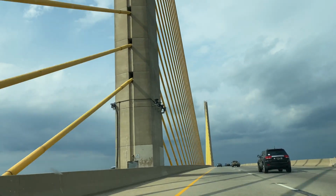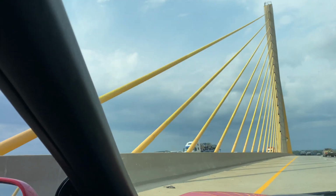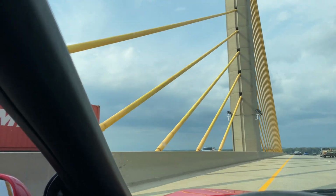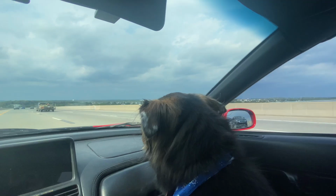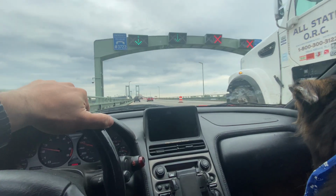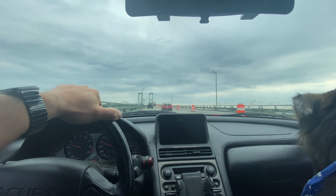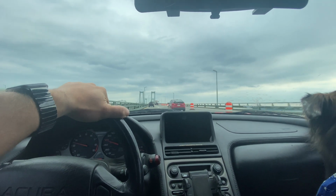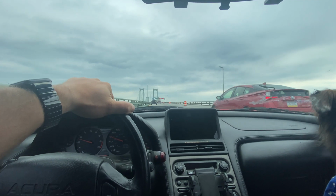The reason I want to upgrade it is because the 7400 kit that I have in here now, which I'm sure is a great kit for its purpose, which is load leveling for pickup trucks, does not really work on a trailer. And the reason is it constantly self-adjusts. So if I'm driving down the highway right now with my trailer and the air suspension has power going to it, all of a sudden one side will just lift up randomly and the other side will drop down. That's dangerous for driving trailers. You don't want the weight just shifting.